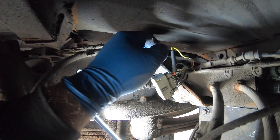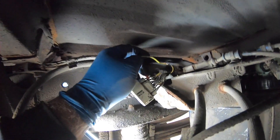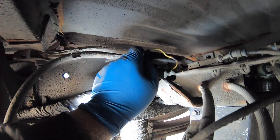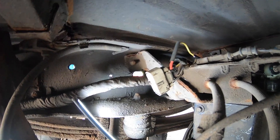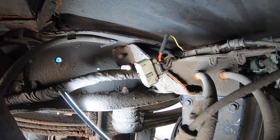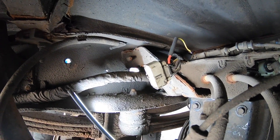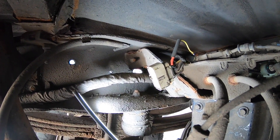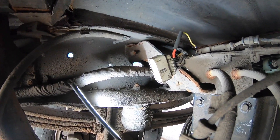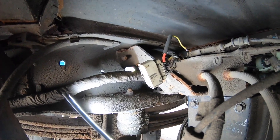I've got a little extension of wire in there because I couldn't make it work otherwise. I soldered it back together on both ends and put a little extension in. I'm not going to replace the entire harness — that'd be absolutely ridiculous for one little crimped wire. I'm going to get this heat-shrunk back together, plug it back in, clear the code, start it up and see if the code comes back. Before, if I cleared it and restarted, the engine light would come right back on.